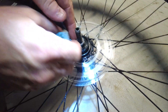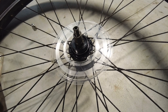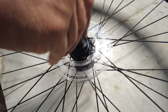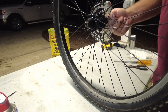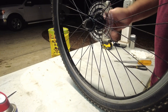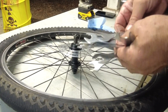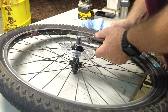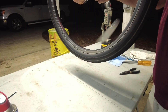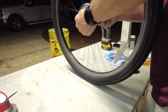There are only a few more steps before putting the sprocket back on. I'll start by putting a spacer on this side, then there's a lock nut that goes on — this creates the gap where the sprocket sits and mounts to the frame. Once that's done, I'll check that the bearings roll smoothly without binding and that there's no play in the axle, then use special flat wrenches to tighten everything up. When done, the wheel should spin freely without the bearings binding or having too much slop.